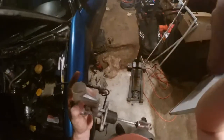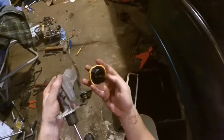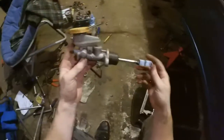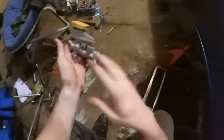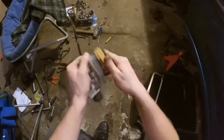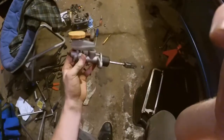A lot of people do this online. I cleaned it up and took this little extra spacer plate off, which gave me a little more room. Now when I pop the lid in it has a suction seal, and it only goes just a little below the max line, so it should hold plenty of fluid. I have an extra master cylinder just in case this one doesn't work out. I've seen other people do this on Legacy BBS forums, so it should work.